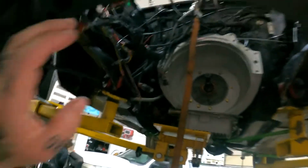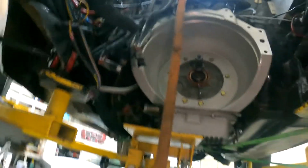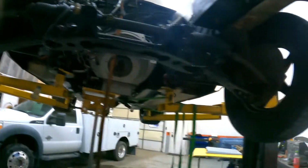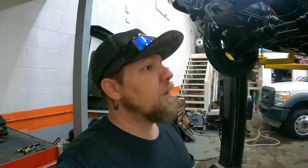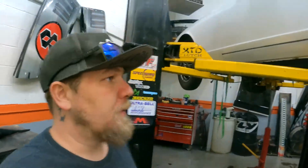We still need to get the wire harness out and just kind of get it ready for the LS to come in. I'll say LS as well, it's just a 5.3. I've already ordered everything for it. So I've got the turbo, I got all the hot side metal. We're gonna fab everything up. We're gonna fab our own turbo kit. But all the piping that I need, blow off valves, wastegates, flanges, everything, I've already ordered. We are gonna be running the Holley Terminator X for the computer system on it. So that'll be kind of nice. Something that's easy, something I've kind of used before.